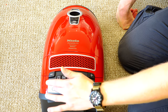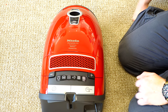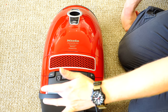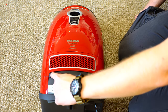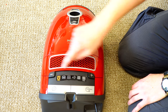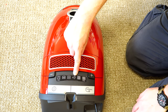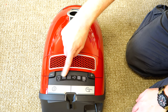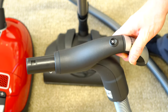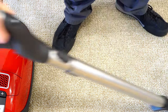On the body of the machine, we have an on-off button right there. These are designed to be hit with your foot — you're not going to harm anything by standing on it. We'll bring it from minimum to maximum. I recommend using maximum when picking up off the floor and for most duties. The ear setting is the lowest you can set it and it will still pick up off hard floor. I recommend using the minimum or sofa setting for dusting. On more basic machines, all you get is an on and off button, and a switch to turn the carpet agitator on — that switch toggles between bare floor and carpet.